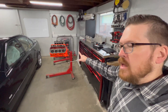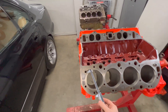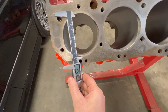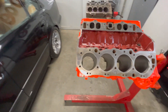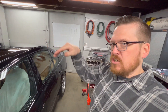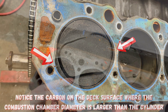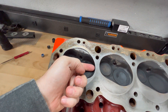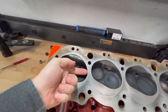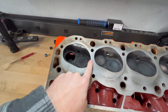Remember, this block only has a four inch bore. So we have a combustion chamber with a diameter that's almost a half inch larger than the deck surface of this block — meaning the combustion chamber is actually overhanging the edge of the block. So when you have air coming out from the valve, especially on the intake valve, it's so close to the edge of this chamber that it's actually coming out off the valve and running down the side of the edge of this chamber, shrouding it, and then hitting a ledge on the deck.